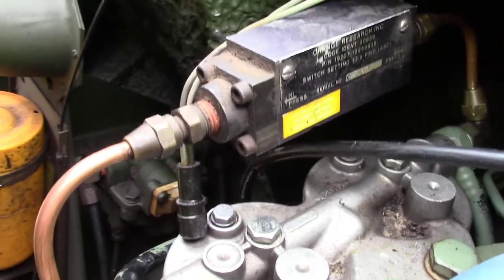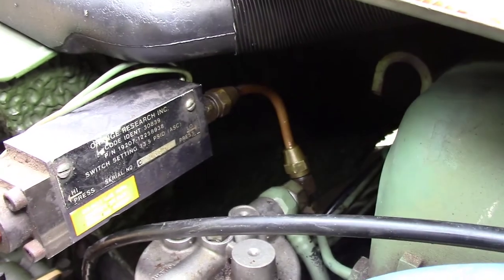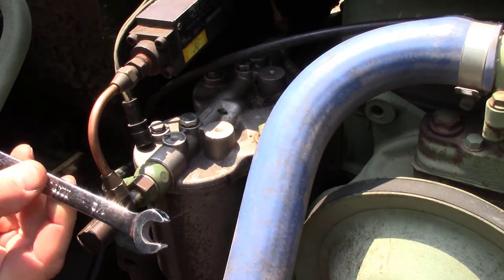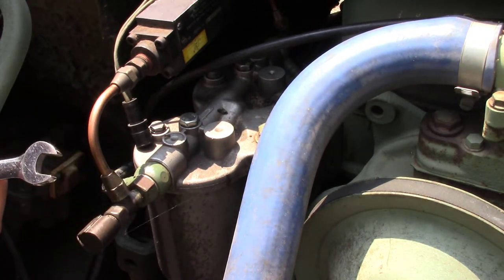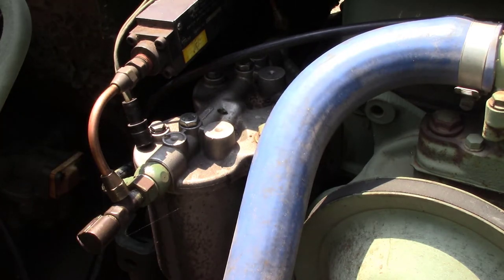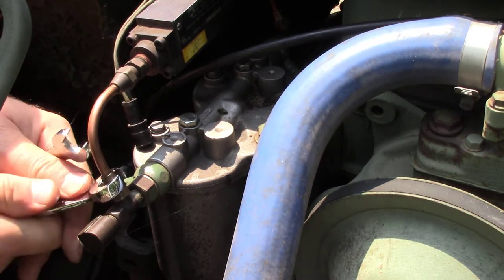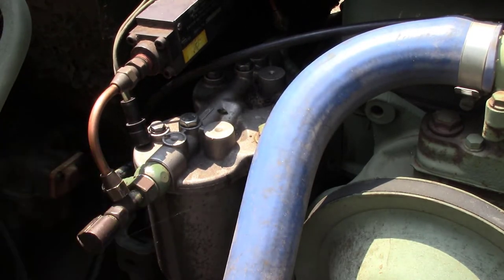There's the plug, and the vehicle's been running fine. So we'll go ahead and pull that off, and then cap those off, leave the system, and get it running again. I grabbed my half-inch line wrenches here, and I also grabbed a regular gear wrench. If you don't have anything specific like that, this guy always works too, but since we have the right tools, let's go ahead and use them. What I'm going to do is just pull this compression fitting off.